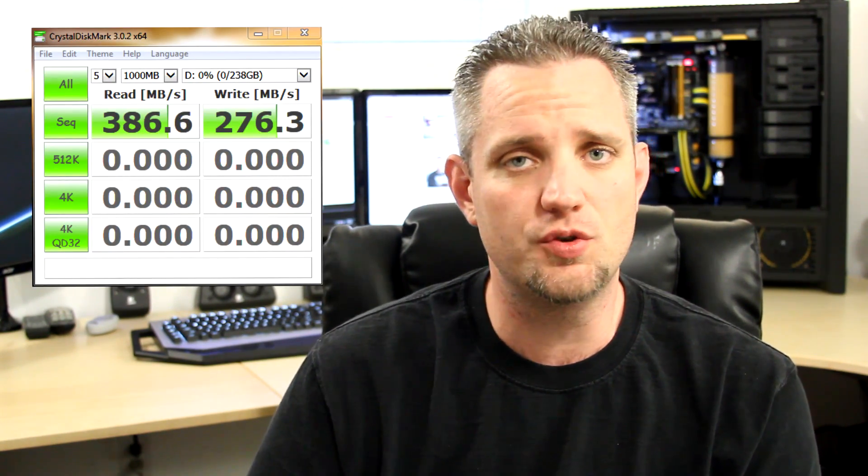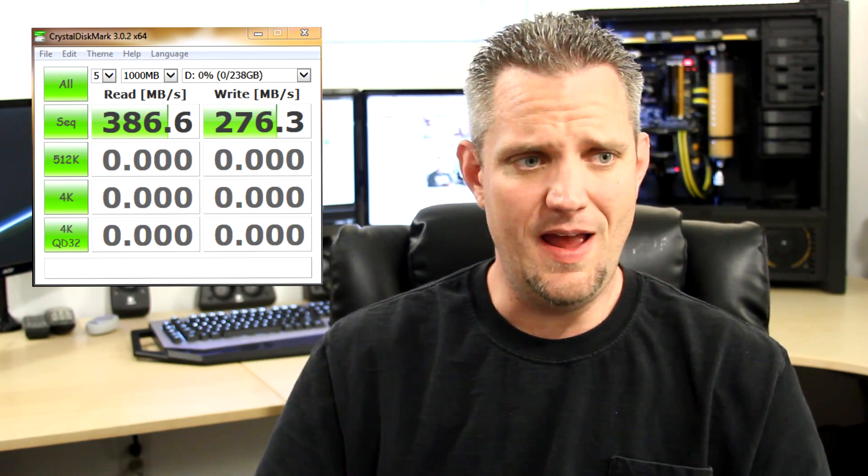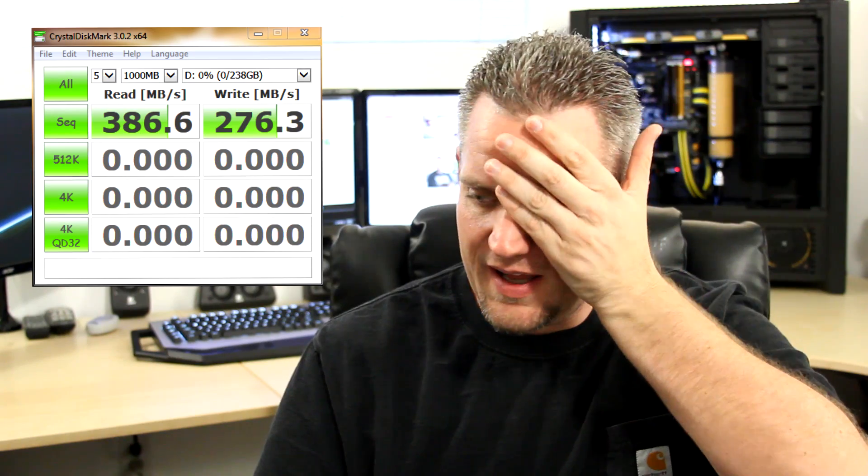Now there's not a whole lot to say about the looks of an SSD, but I know what you guys want to know — you want to know how well this thing performs. When I first hooked it up to my system in one of my hot swap drives, I was having some very sporadic performance. The first bit of performance was about 250 megabyte by 250 megabyte read-write speed in sequential, which was quite a bit lower than advertised. The hot swap drive I plugged it into was a three gigabit per second port. Make sure you have it in a six gigabit per second port — most motherboards today have at least one or two, or in my case six. So I moved it over to a six gigabit per second port and was only getting speeds of 386 sequential read by 276 megabytes sequential write, which was still much lower than advertised.